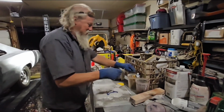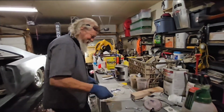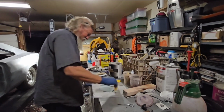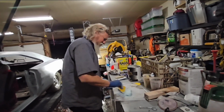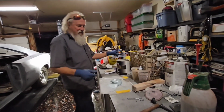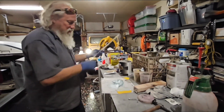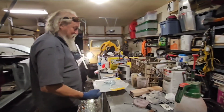You definitely have to come see my paint booth too. I want to be the first to use it, to be honest with you, man. Get it ready, you will be. Yeah, I would like to use it if you let me. Oh yeah, I will. Just because I don't want flies and stuff, because they get in that clear coat and leave their tracks and all that. I've done several outside, by a tree. You do it in the morning when there's dew out on the ground, the humidity's up. You can spray some pretty nice paint jobs outside.